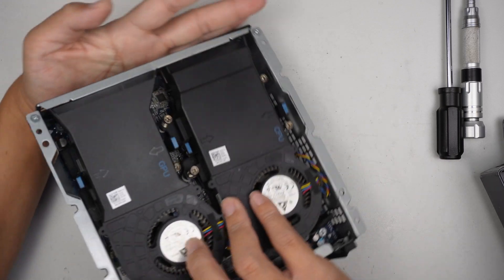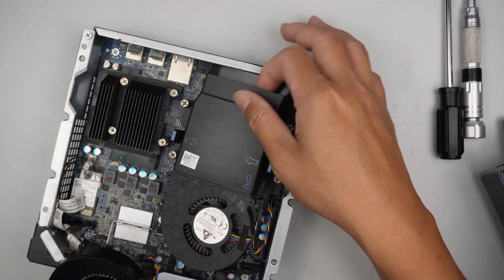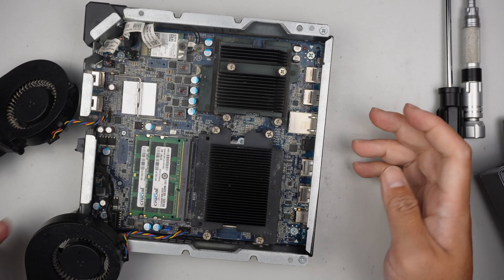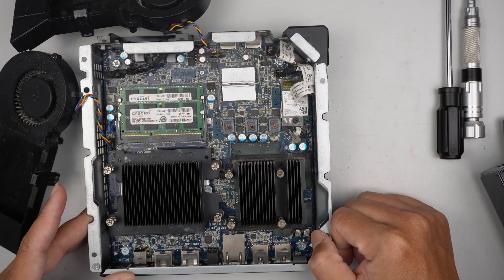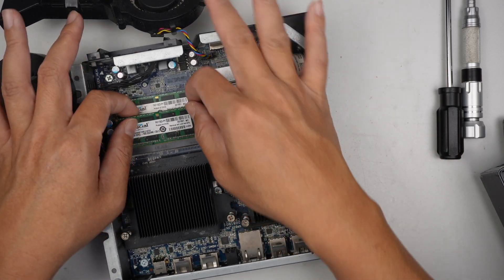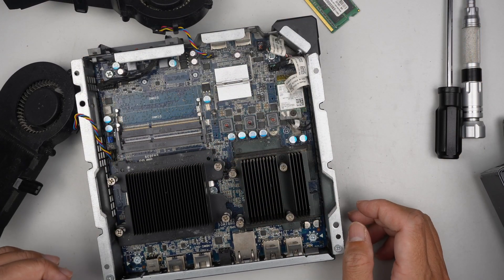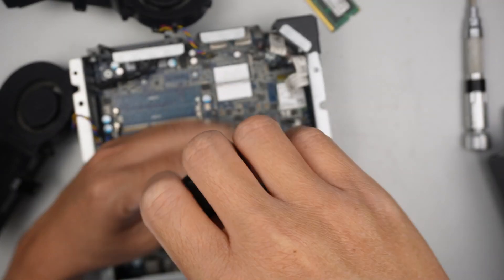According to Dell, a five flashing amber light is referred to the CMOS. But definitely I couldn't see the CMOS here in the computer. Let's try to reset the RAM and see if that helps. Let's take a look at what is in there, just to be sure.